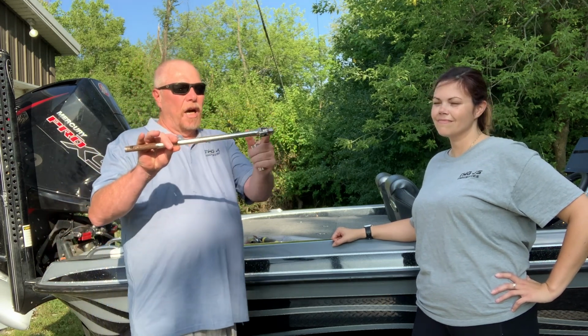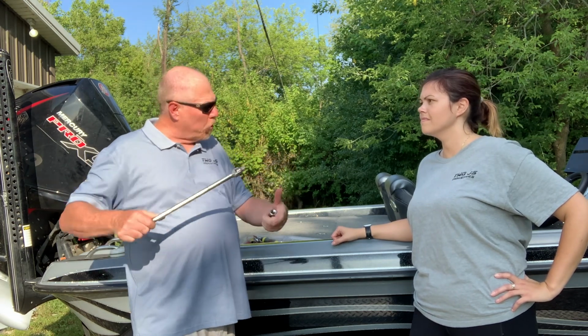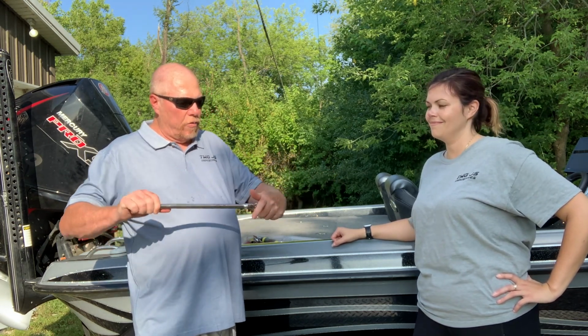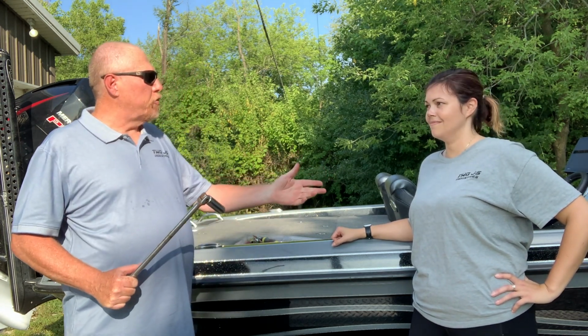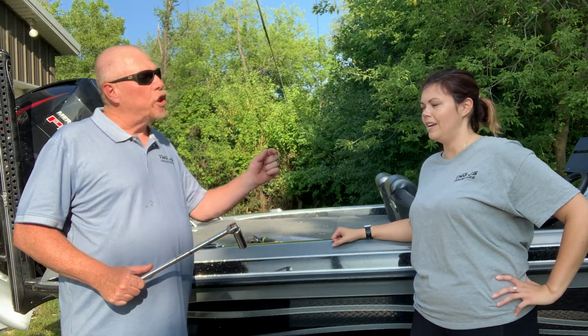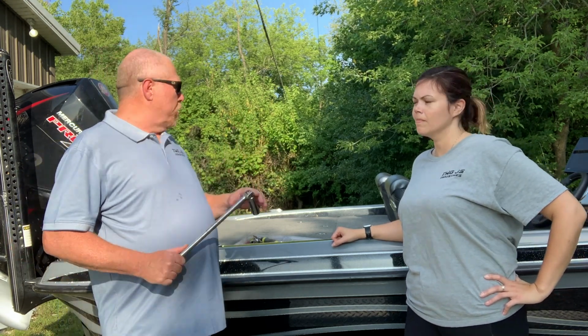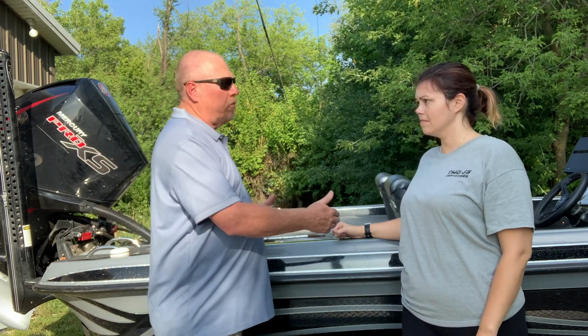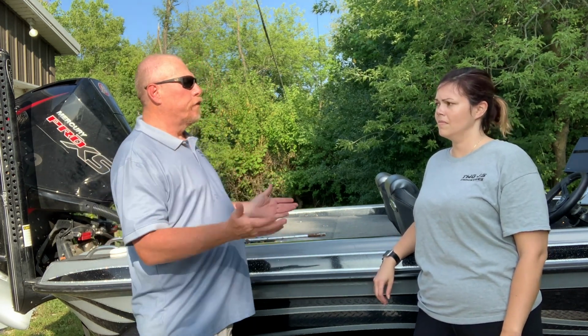And then I've got a pry bar kind of wrench, a long handle wrench, because the longer the handle, the more leverage you get, right? So I know I've always got a tool to take the lug nuts off. And you remember from what we did last weekend, you always loosen the lug nuts while it's still on the ground, while the weight's still on it. You just loosen them to break the seal and get them loose. Now here's what I do moving forward. You don't need a jack. On a tandem trailer like this, any block of wood, any curb, any rock will serve as a jack.